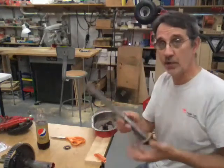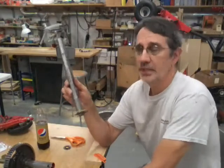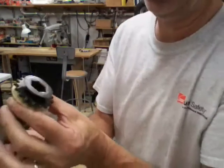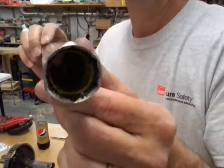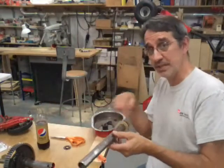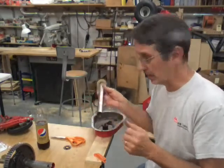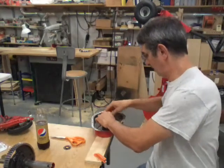The next thing we want to do is take your hex tube. I've had a couple of comments asking what keeps the hex tube from rattling around on that three-quarter-inch shaft. Well, if you look inside this end you can see that yellow — that is an inserted bushing that the shaft spins inside of. So if you've got a lot of slop or this thing is rattling around, your bushings are worn. We want to drop this in here next and mesh the chain into the sprocket.